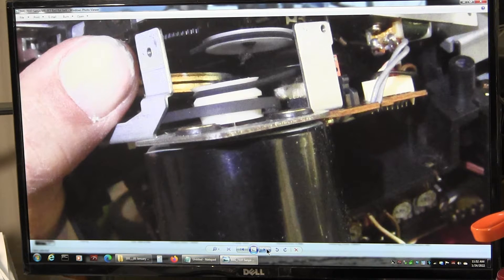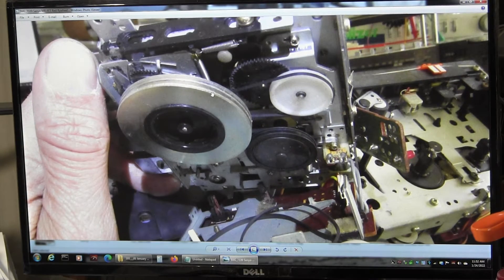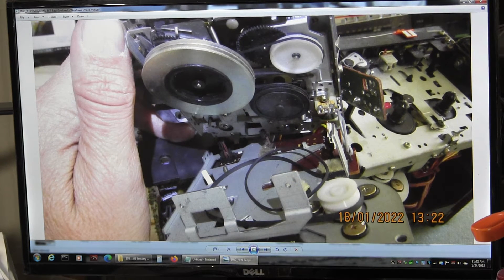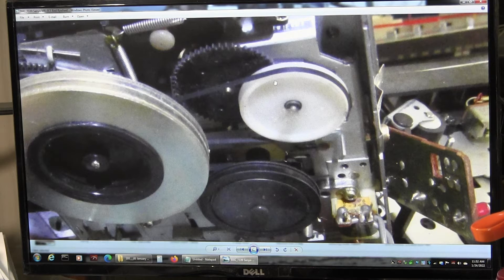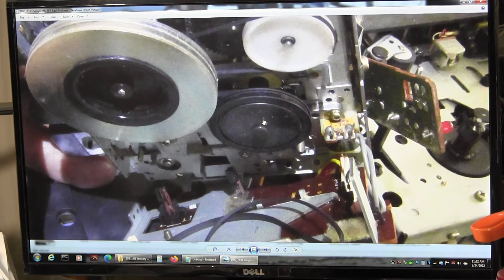The whole idea is to get that flat belt on first, and I had a devil of a time with it. Here's the underside — the flat belt area — and you can see there's no track on the flywheel. That belt underneath drives the flywheel, and the flywheel drives a white gear which drives another gear — that's the auto-stop mechanism. The rewind/fast-forward arm goes back and forth like a pendulum. If the belt is loose, it won't operate in fast forward, but it'll work in rewind. That's what I showed in my previous video: the FF7 would not fast forward, it would only rewind.